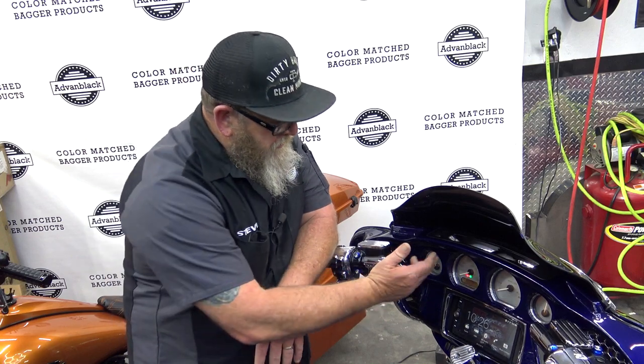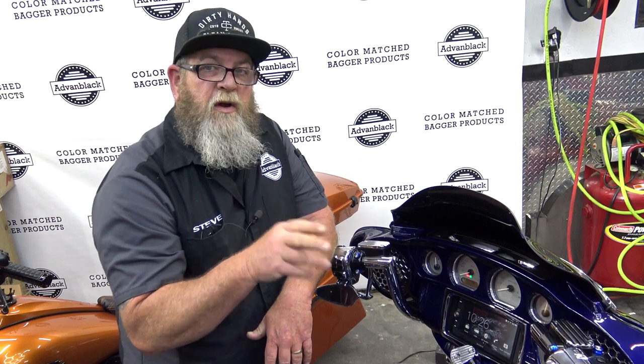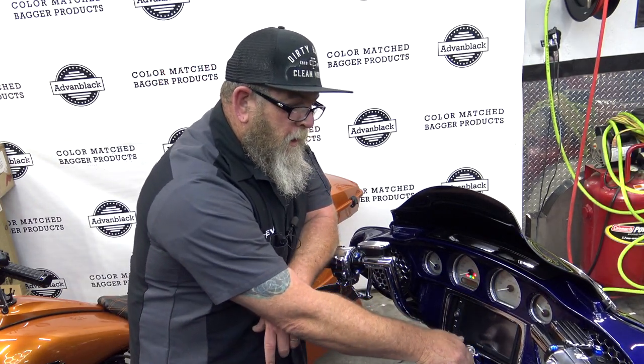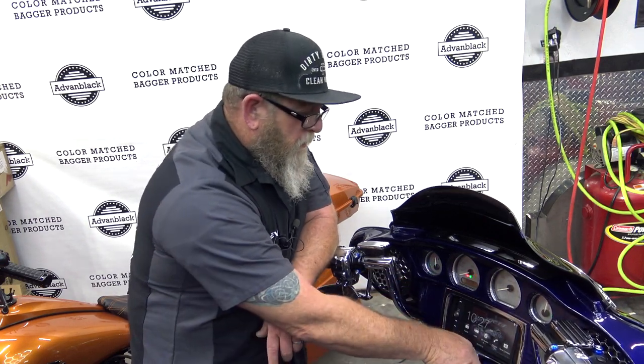Now, if you've never had LED lights on your bike and at this point you have hyper flashing on your dashboard — let's say you hit your turn signal and the inside turn signal on your dashboard is flashing really fast but your turn signal on the outside is working correctly — that's called hyper flashing. What's going on is the ECM on the bike thinks you have a turn signal out. The LEDs take a significantly less draw than a standard bulb that comes in these bikes. To reset your ECM for LEDs, kick the bike on, go over and hit your hazard lights, make sure your hazard lights come on, and turn the bike off. Let those hazard lights run anywhere from one to five minutes. On some Milwaukee 8 models, you may have to actually start the bike during this process. Once the inside turn signals and outside turn signals are blinking at the exact same time, it's reset.